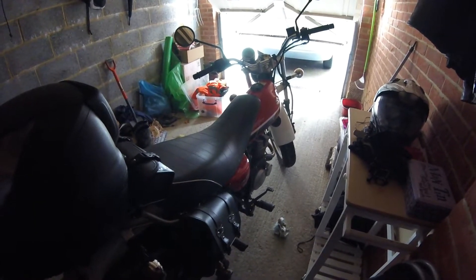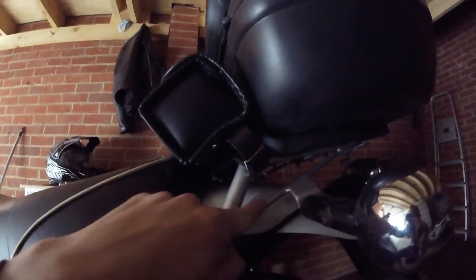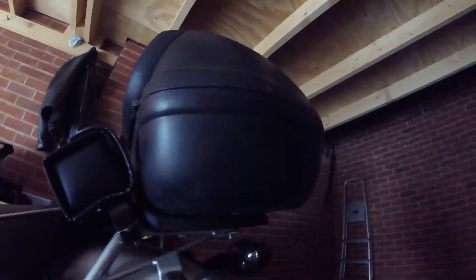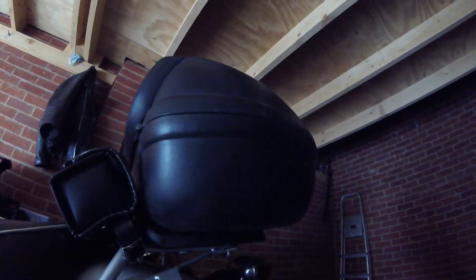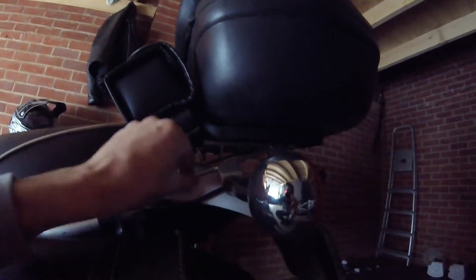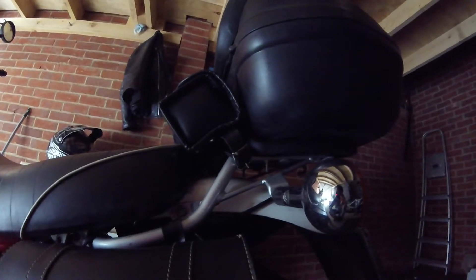So yeah, that's what I was going to show you guys today. Overall storage on the bike now: I've got the two side panniers, I've got the tool roll here, and I've got a relatively large back box. The one other thing I do want to do at some point — my brother is actually a welder and fabricator — so I'm going to get him to just strengthen this rear rack a little bit. It seems to take the weight fine, but this is a relatively large top box — I had it on my 600. Once you start putting heavy things in it like work boots, I worry the rack isn't quite strong enough, because it's thick here but the bit it's actually sitting on is really thin. We're thinking of welding and infilling it basically, just to give it a bit more structural strength.